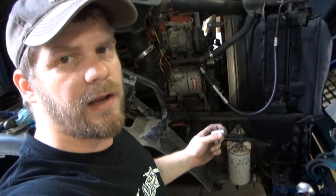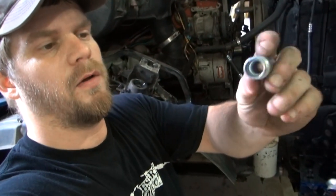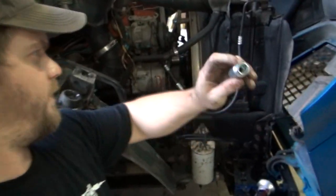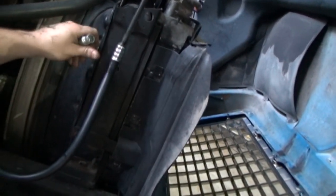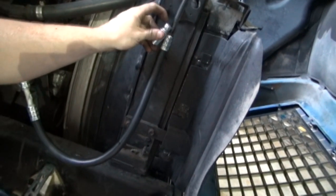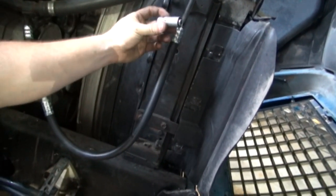All right, guys, well, that's that. I do want to show you guys these weld on ends as well. Say if this tube here is messed up where I cut this ferrule, if you mess it up, you just whack it off here and slip that over the top of it, weld around it, and then you got a new end on your tube.